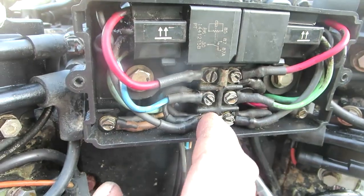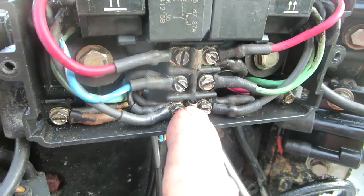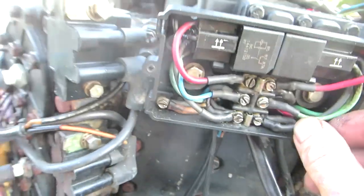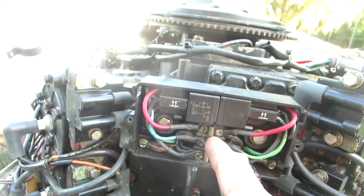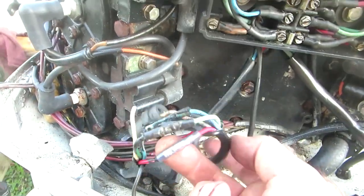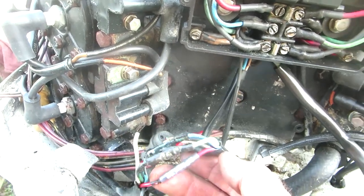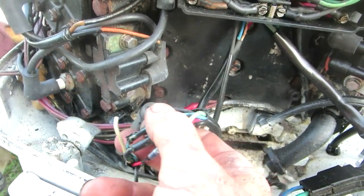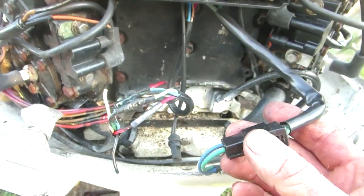You see these terminal strips — you need to clean both sides of the wires so they make a good connection on these little straps. These are your up and down wires. Power comes in here, goes through here, actuated through these wires. 12 volts runs through all the way to that switch, alongside the blue and green wires. The switch connects 12 volts to either the green wire or the blue wire, which runs back through the relays out to this connector.